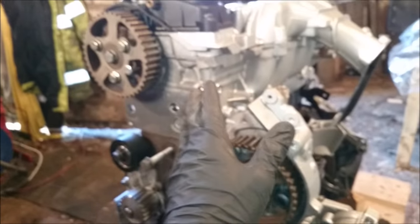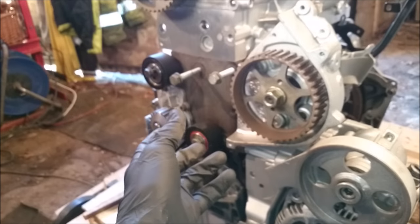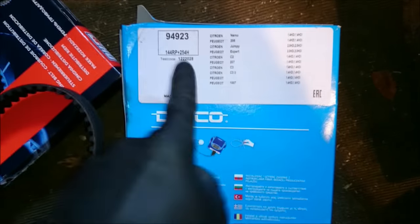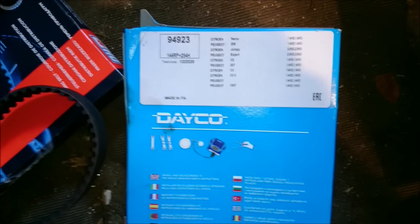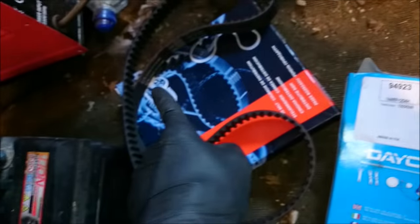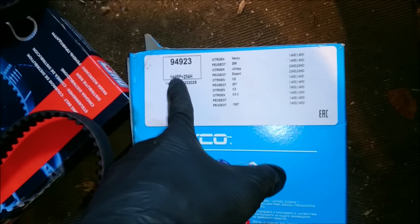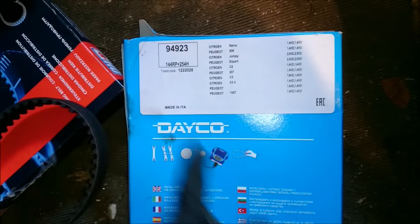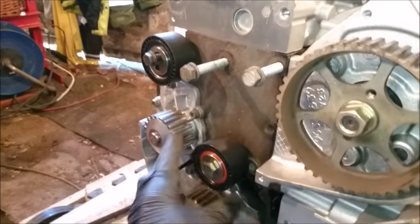That's also where I made a booboo: the 16-valve head is that little bit taller than the 8-valve head that was originally on this block, because this is an 8-valve block. So we actually can't use an HDI 8-valve cam belt. There are two cam belts here - one is 141 teeth and this one is 144 teeth. You'll need the 144-tooth HDI cam belt, not the 141-tooth belt. I think there's also 146 and 148 for the 2.2, but you don't need that if you're doing my sort of setup with the 16-valve head and the 8-valve bottom end. Obviously you'll need the 8-valve kit because you're on an 8-valve bottom end with an 8-valve pump, which we've already fitted.